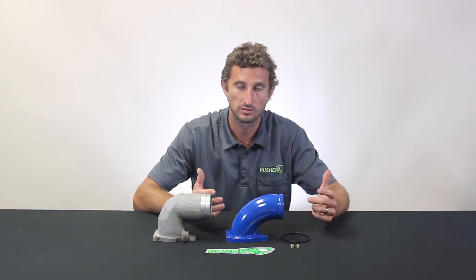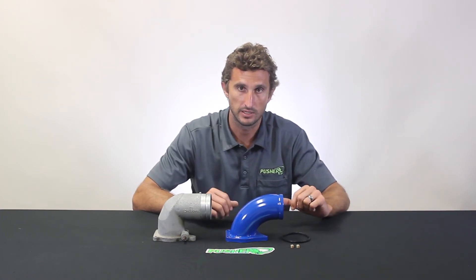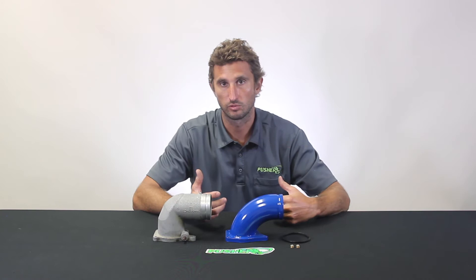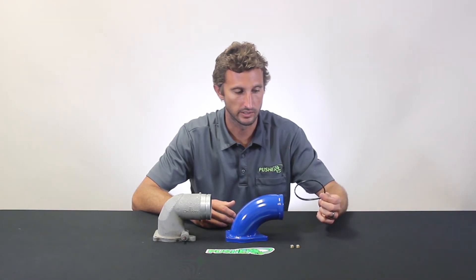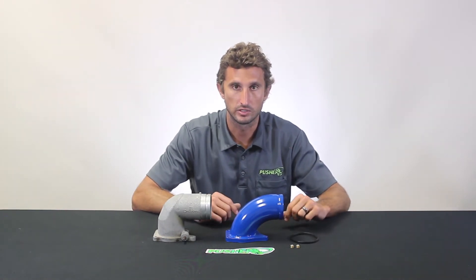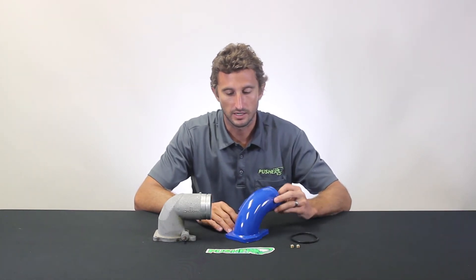These O-rings are great because when you're building or maintaining a truck, things are going to get put on and taken off once or twice. O-rings handle that a lot better — they don't get damaged like a rubberized felt gasket, RTV, or something similar that you'd have to replace every time. These are pretty much unlimited in how many times you can install and remove the part.